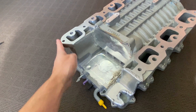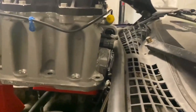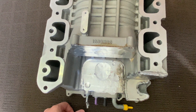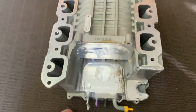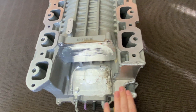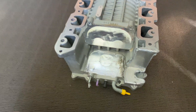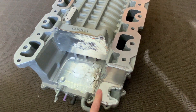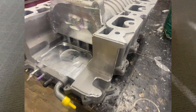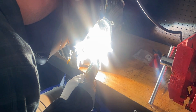I had this section of the blower pretty much right on the edge of the engine bay where the seam is for your bonnet, and it was just never going to work. So I figured, go all out and hack this thing up — it either works or it doesn't. I threw it in the CNC and milled away this corner, then traced this pattern, put it in the pan brake, folded it, and tagged it in. I think it turned out pretty nice.